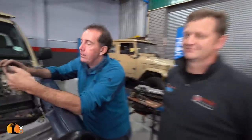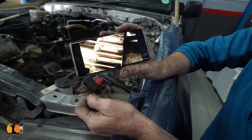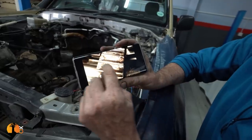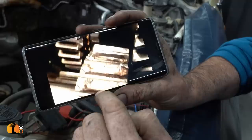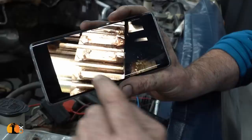So Andrew, we found the problem on your gearbox — that's your reverse gear. Unfortunately the reverse gear is not looking too healthy because, as you can see, all the teeth have been broken off. That's how a tooth should look, and this is what's left of the reverse gear. Usually on these gearboxes, when you run-start the car in reverse, that happens. When you do a push start in reverse, that happens — it just knocks the teeth off, because they're not designed to go backwards in the opposite direction.